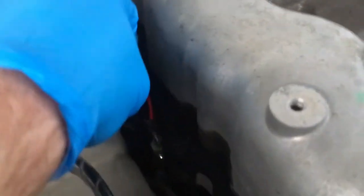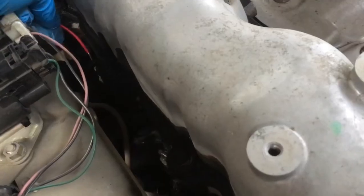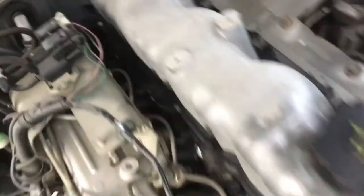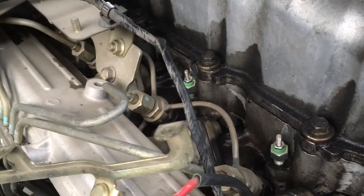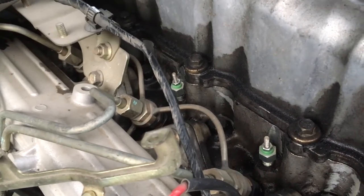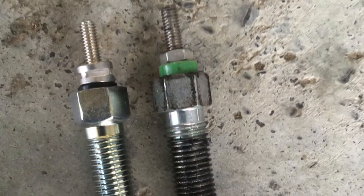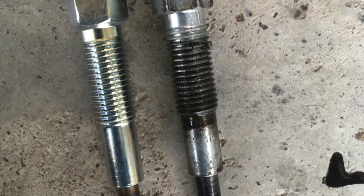Let's see what we've got further back. That one has got a bit of spark, and that one has got a bit of spark too. So we've got one definitely dead glow plug; the others are probably on their way. We will be replacing all four, and then we'll have a quick look again with four new glow plugs. Make sure your new glow plugs match the old ones, including the voltage rating on them.